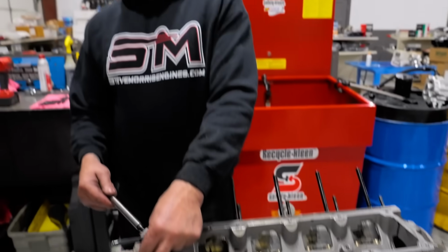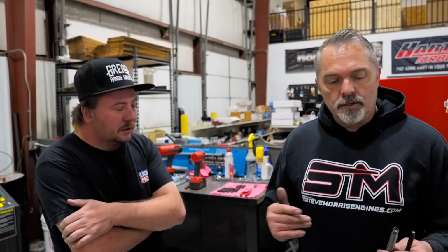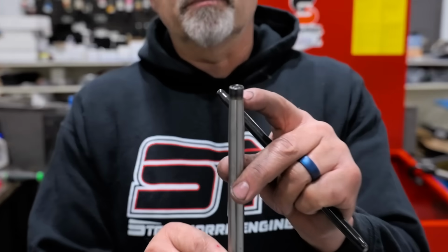So, to go into what the problem is here, at some point in time, way back in the beginning, you said you had an oil pressure issue, and hot. It was like 5 pounds oil pressure idling. Yeah, idling. Not running wide open throttle, but idling. And it probably, with a combination of oil and oil pressure, it had burned up. You see the bluing in there?